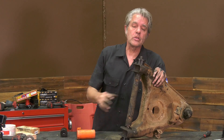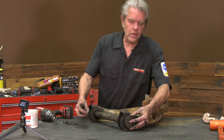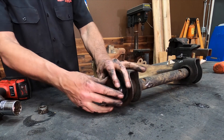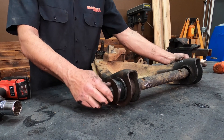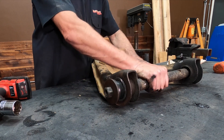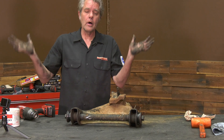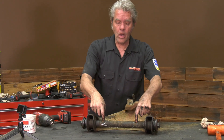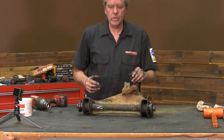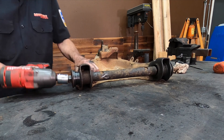This table is a little weak, so I'm going to need to do this on the ground. I've got my urethane bushings in as far as possible — I have to get them in at least enough to be able to get a nut on one side and get some threads on there. We're going to take our big washers and put them back on. Now I can go ahead and tighten these in and they should draw it on in. Now when I'm tightening these up, it's going to be really difficult to move this shaft. Notice on this shaft it's got a hole right here and a hole right here — on the front cross member there are pins in there that line up to this, and they are generally just a little off from straight up. So we're going to have this in as close to the right position as possible before I tighten these up, because it's harder to do after.